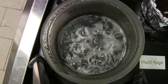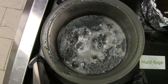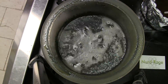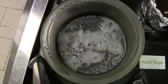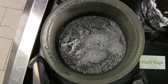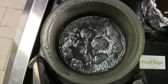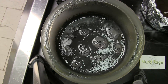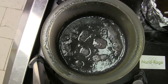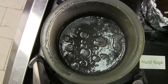Now, the platter is made of aluminum with an ultra-thin coat of magnetic alloy where the data is recorded. In some hard drives the platter is made of glass or ceramic, but I'm pretty sure this particular platter is made of aluminum. The exact composition and structure of the magnetic coat changes as the technology evolves, but generally includes such elements as iron, chromium, cobalt, nickel, and even some precious metals like platinum and ruthenium. Whatever the exact alloy is, it's resisting hydrochloric acid. Now, before anyone has any ideas, the precious metals are not valuable as scrap — the coating is so thin as to be worthless.